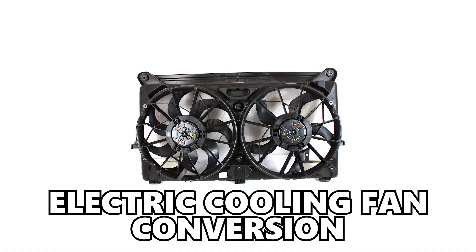At those power levels you're going to need things like head studs, valve springs, an electric cooling fan conversion, a radiator upgrade, and at that point you're looking at more serious modifications like porting the heads, upgrading or porting the intake manifold, and many other advanced modifications to really improve airflow. These engines do respond well to supercharging and forced induction, but once you add that, the list of supporting modifications builds up quickly — making it a pretty hefty build from a cost standpoint to push serious power.